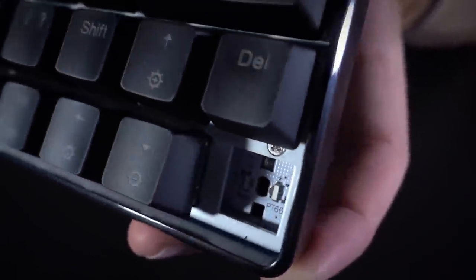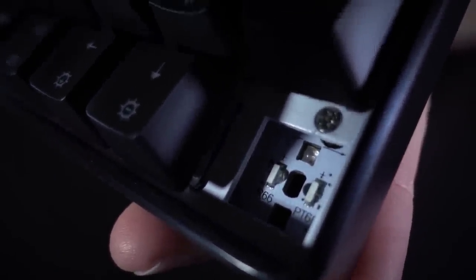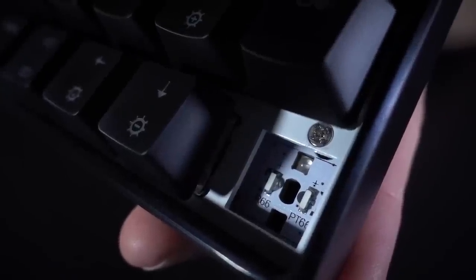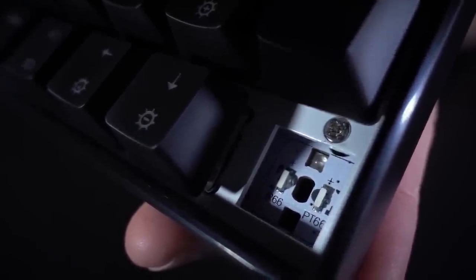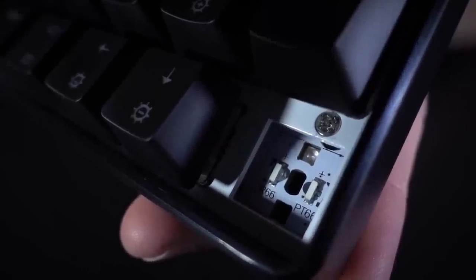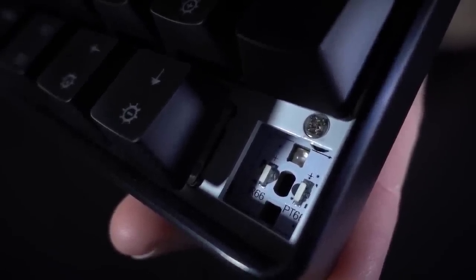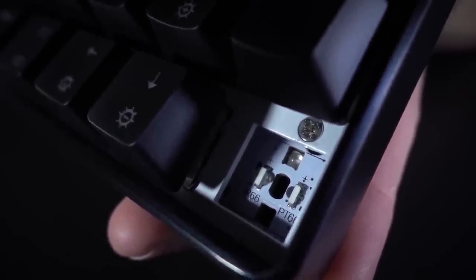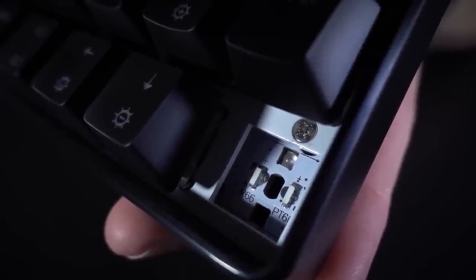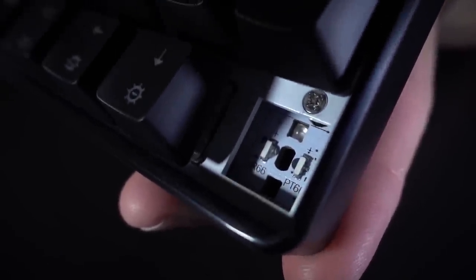It's got... there you go. You see? That is the IR transmitter and receiver on either side of that socket. It's the big hole in the middle there. Then on either side there's a little structure. I think that's what's shooting the IR beam. It's through there, and then when it gets broken by the bottom of the stem on the switch, that's how it registers a keystroke. So that's a little different than what I thought, actually.